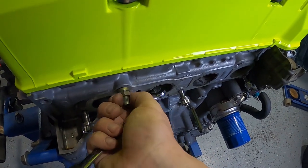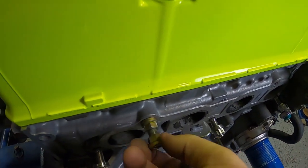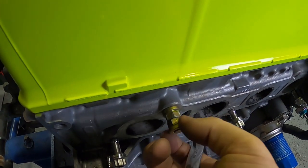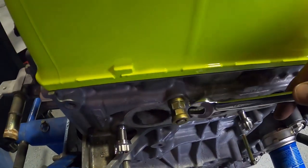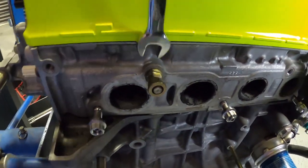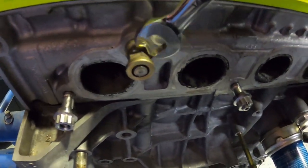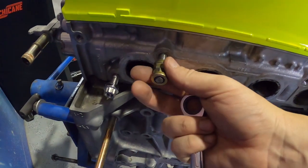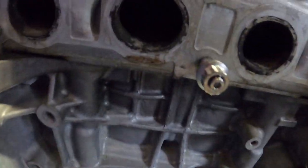So we'll just wind that all the way down. These nuts that I've got are pretty bulky, and that's really the best I could find. They're a weird shape for exhaust studs. And get the other one on. Tighten them against each other, and then you use the back one, pushing against, there he goes, the force of the front one. Sorry about the camera angles, but it does require a little bit of strength. And then continue doing that. You can see it's backing off there until it's out. And then once it loosens off, you just take it out. And then you can replace it with your new shiny titanium studs.